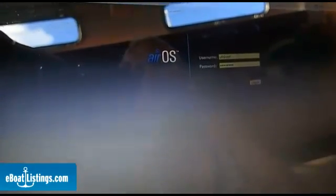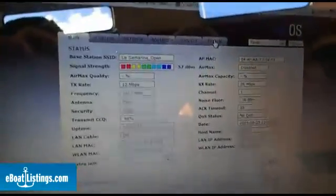Now we can connect to the bullet through a web browser. We're going to change the IP address of the bullet to a less commonly used neighborhood in the IP blocks. The original IP address on your bullet is 192.168.1. We're going to change it to the 192.168.10 neighborhood to avoid conflicts with common IP addresses on other devices. So you're going to type in a web browser the original IP address of your bullet, which is 192.168.1.20. We've already changed ours so when we put ours in it's going to be 192.168.10.20, but you're going to put in your original IP address. The original username and password is UBNT and the password is UBNT. In our case we've already changed ours, so once you put in UBNT, you're going to log in and go to System.